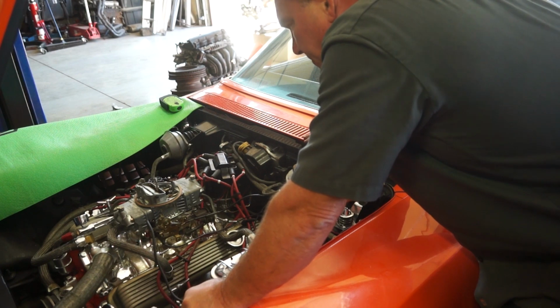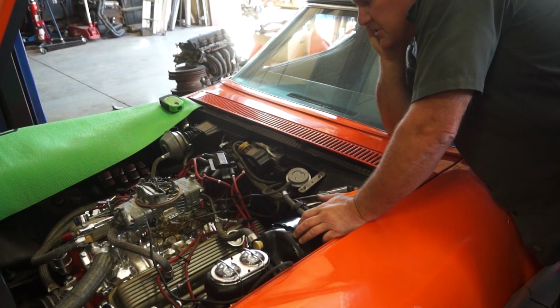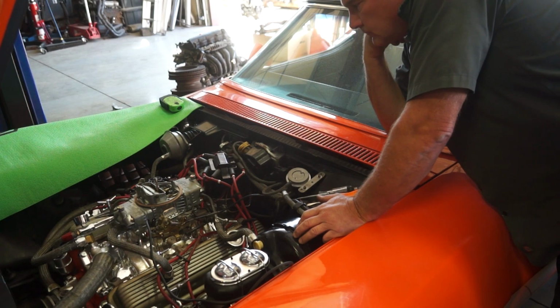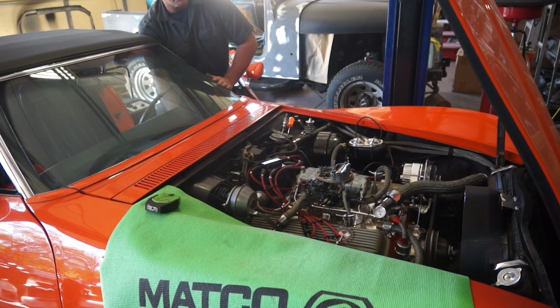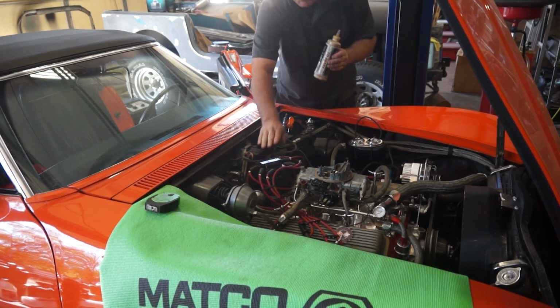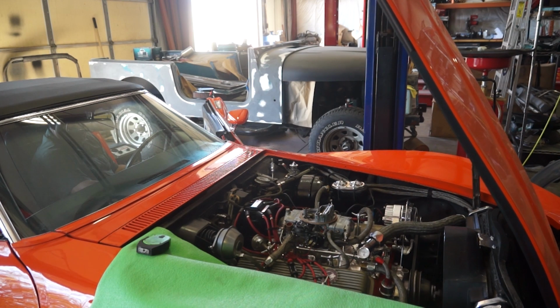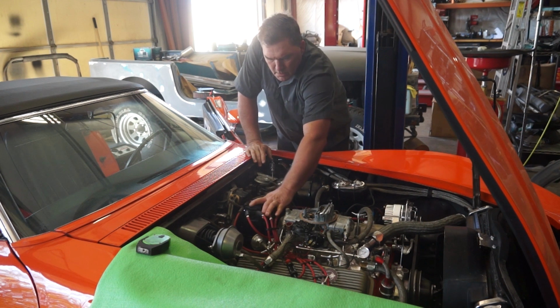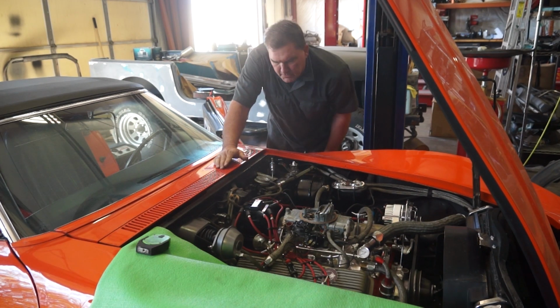Well, I have a power supply problem. So I have spark, but only at cranking. My voltage is low. That feed should be straight from the ignition switch. So I guess I'll check to see if I have power coming out of the switch. Not in time. So we have spark. Probably gonna bump my tooth over one, but I think I'm pretty close. Now I gotta figure out why I don't have power key on.